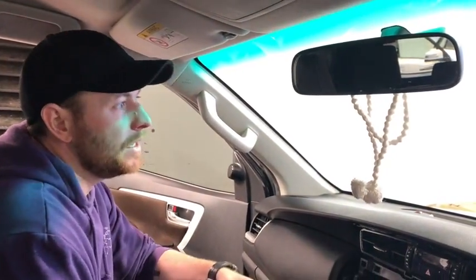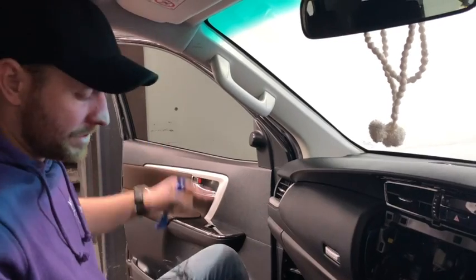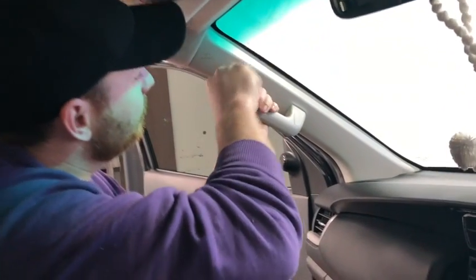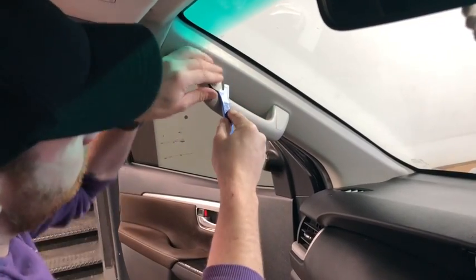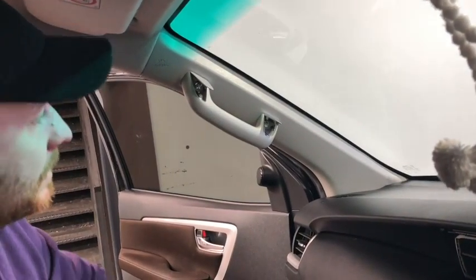Now we're going to run the microphone. It does not retain the factory microphone because the new one has gain control and noise cancelling on the Kenwood unit — we've tried to adapt to the factory microphone before and it does not work properly. So you do need to run the external mic; it comes from Kenwood in the box, no problems there, and it looks very discreet. Up here, you're going to pull this A-pillar off — again, non-marring pry bar — slot it in behind here and it's very easy to clip those up.